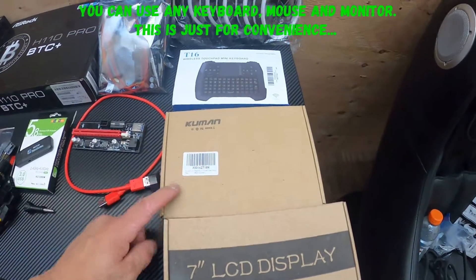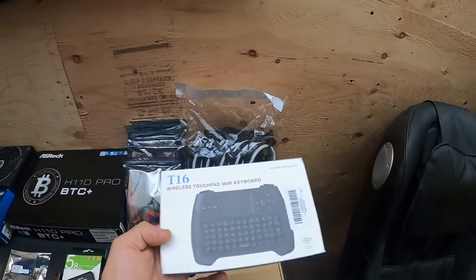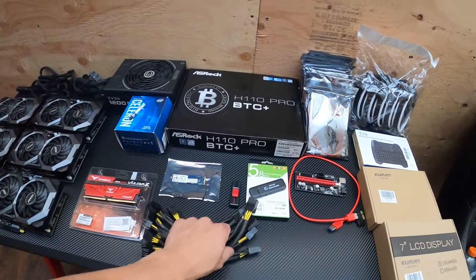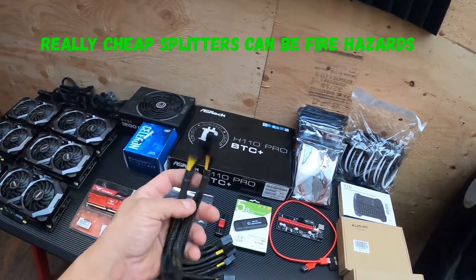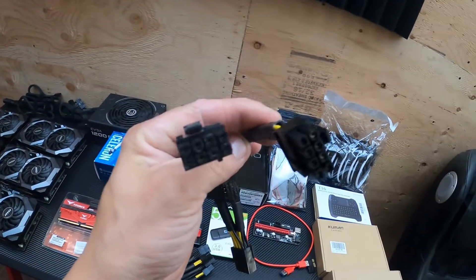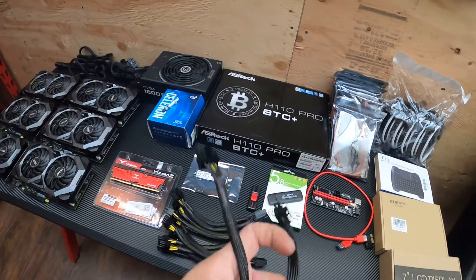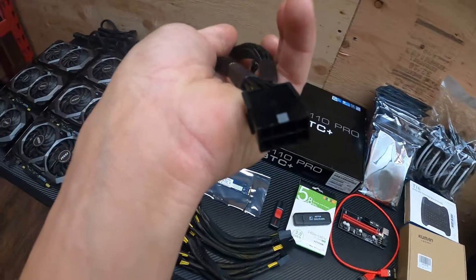Alongside this, there's a seven-inch LCD display and a frame for the screen — it literally makes this rig completely independent of an external mouse or keyboard. The only other thing I didn't mention that you're going to need is splitters. Get something that's decent quality. These are basically eight-pin to eight-pin and can break down to six, just like the normal ones that come with your power supplies. I'm going to jump from PCIe riser to graphics card off of one VGA eight-pin.